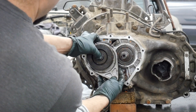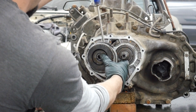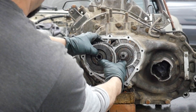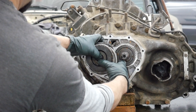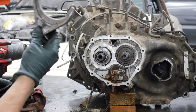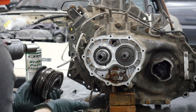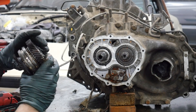Wiggle it and move it at the same time. I would advise against prying it — you won't have to on yours. It takes a little patience and persuasion. There's the shift fork — that's the culprit for most of the problem. This is the fifth gear pack, and this is the needle bearing and the sleeve — we'll get to that in a minute. This is what you need to keep together.